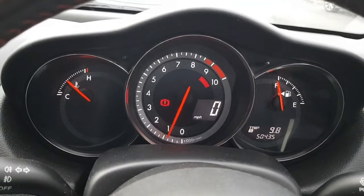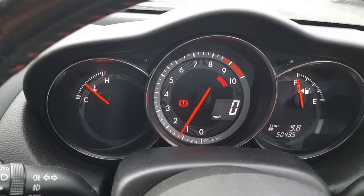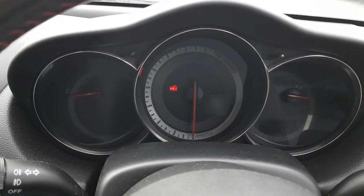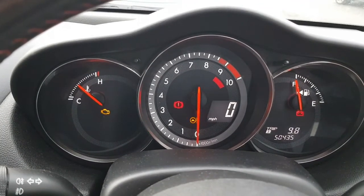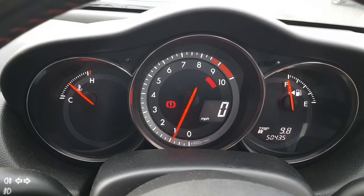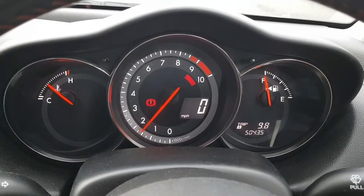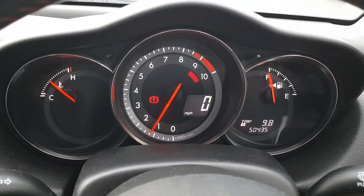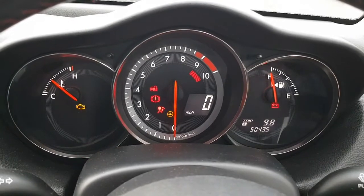But anyway, let's have a look at the hot starting. And sometimes, occasionally, there's a little hiccup like that — the revs drop slightly and it tends to stumble. So let's switch off. And again, without touching the throttle pedal — it's picked up. Similar to the cold start, it usually requires a touch of throttle to keep it from stalling, but it didn't that time. Let's just try it one more time, just to see.